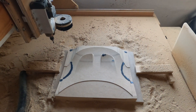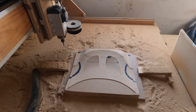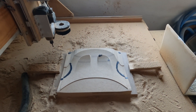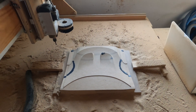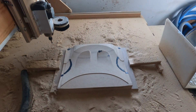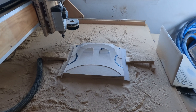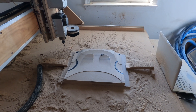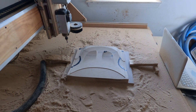When this is cleaned up and finished, I'll sand it smooth and put some kind of coating on top — probably a polyurethane or a high-build primer — and sand it down to a mirror finish. I'm going to make a carbon fiber quarter scale hood on this to try to figure out the process of vacuum infusing a carbon fiber part. I wanted to start with a small scale part like this to save carbon fiber material before I do a full scale one. I may have to make two or three shots on this mold before I have a good part, and I just didn't want to waste a lot of the expensive carbon fiber.